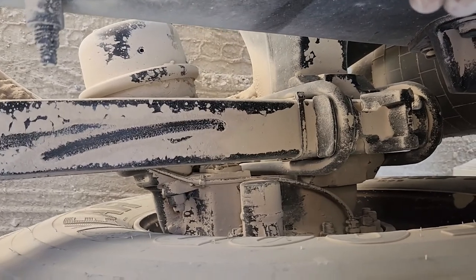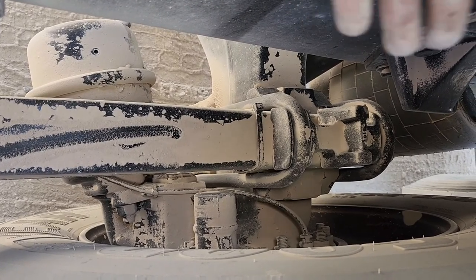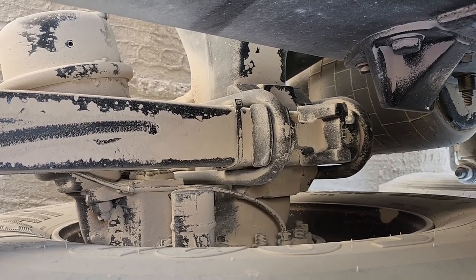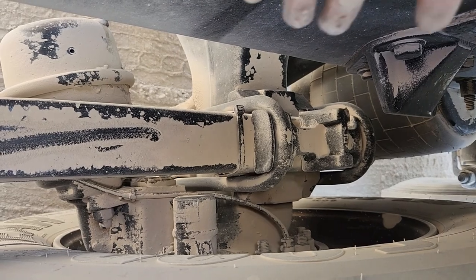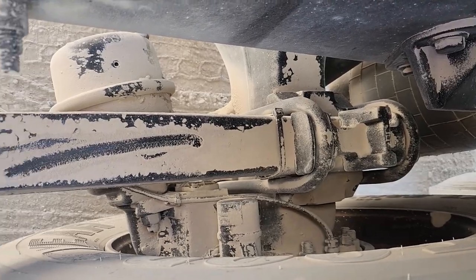This whole truck is equipped with disc brakes. So you will name your disc, your brake pads, and your brake caliper. They are all free of grease and oil, and your brake pads have no less than a quarter of an inch of pad. Everything in here that I named off, you're going to tell them that it's properly mounted, secured, not bent, not broken, no illegal welds, no leaks, no gashes, and so forth.